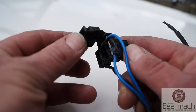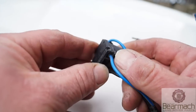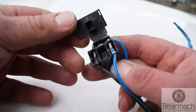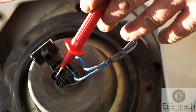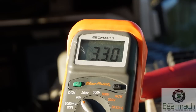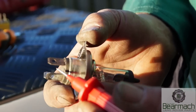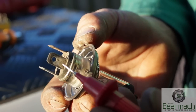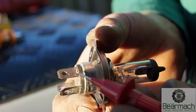With back-entry access you can see the condition of the connectors — they aren't in very good condition. We find a quite considerable voltage drop of 3.3 volts. Basically a voltage drop shows corrosion or resistance in a circuit. The terminals on this light bulb are actually corroded — you can see the condition of them, not very good. This corrosion or resistance shows up as a voltage drop, so we really need a new light bulb in there.